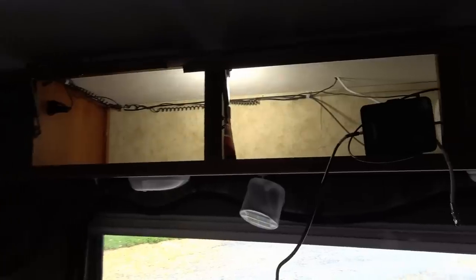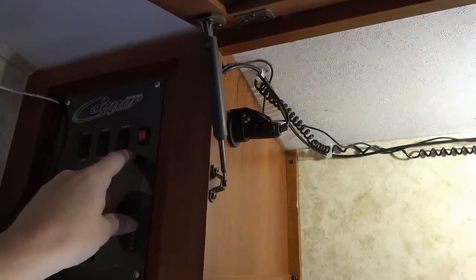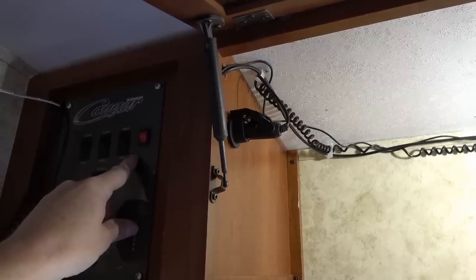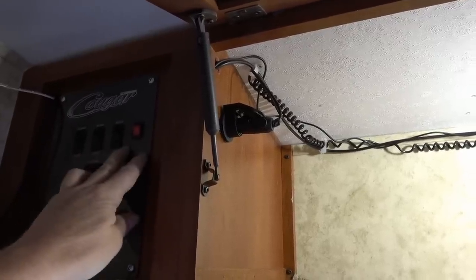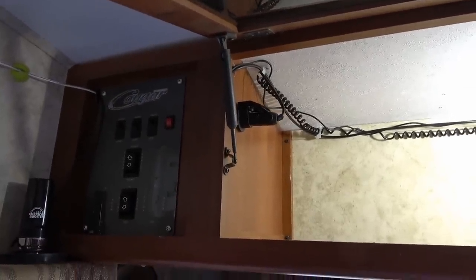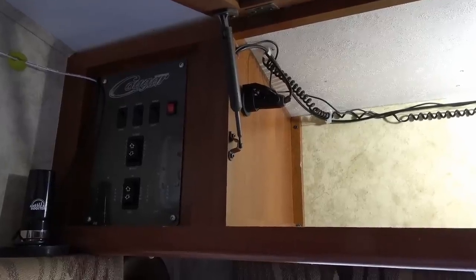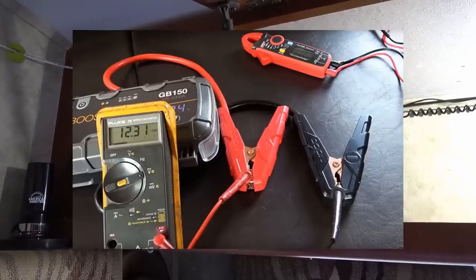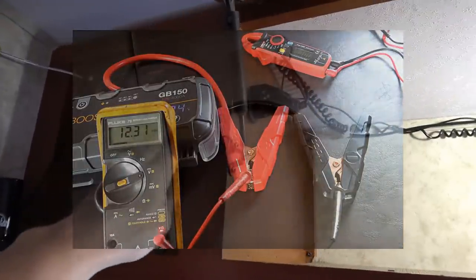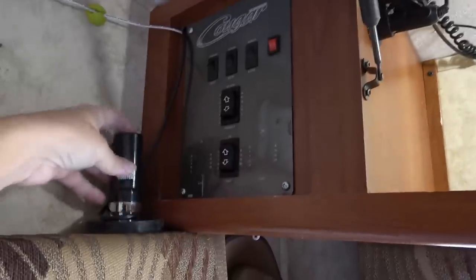I've run my inside cables. On the end of that hard wire there was a red wire and a white wire — the white wire was ground, the red wire was positive. I hooked it into the 12-volt system. If you want to know about finding polarity, because you don't want to hook it up backwards, I did a video a while ago about how to test with a multimeter — I'll link that in the description. So I've hooked into that switch, and when I turn it on it's going to power the wire.